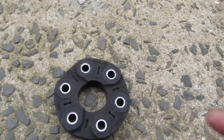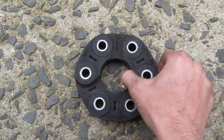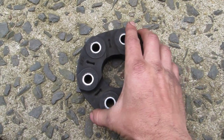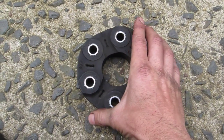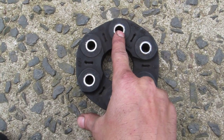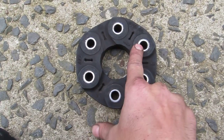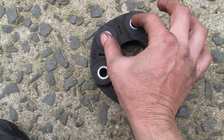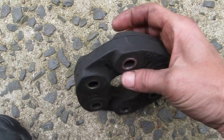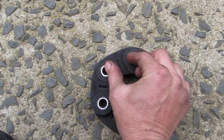A lot of the instructions actually only come in German, so it's hard to understand what they're trying to tell you. But there's a certain way this needs to go on. Everything goes in a counterclockwise direction as you're looking at the back of the transmission. So if we give the transmission these three bolt positions and the driveshaft these three, we have a problem — because we have a compressive force trying to travel over the thin part.